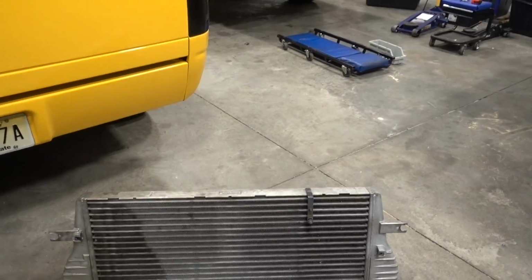So the second reason is, these trucks, when they were built, were not designed to withstand big turbos, high PSI, compound turbos. These trucks were meant to operate at probably a measly 30-ish PSI of boost from your factory turbo, and then diesel performance came around and guys started hopping them up, running higher boost, making more of everything, and the factory parts on these trucks were just not designed with the performance in mind that we are pushing these things to. So the actual overall design is just not up to snuff. And this is where an aftermarket intercooler will be able to handle more of the abuse of what you guys are going to throw at it.